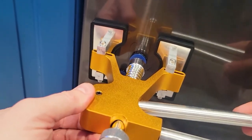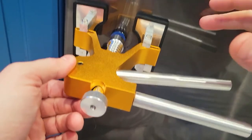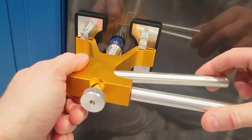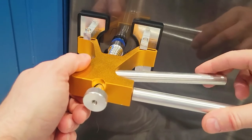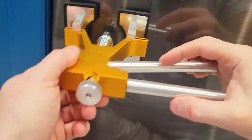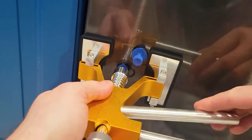Now when you do a slight pull it's already pulling — you can see that. Just keep doing that, not too hard. You don't want to go all the way because you're going to pop the steel out, and this material on dishwashers and fridges is very thin. Just do this maybe 40 to 50 times, then remove the tool and glue and see how it worked. We'll also do the second dent while we're here.